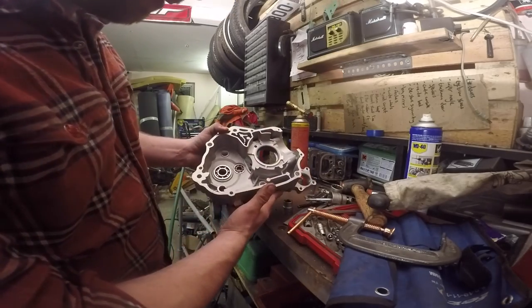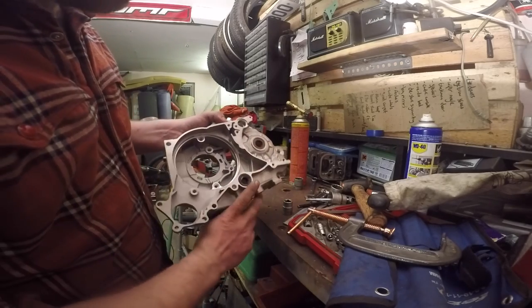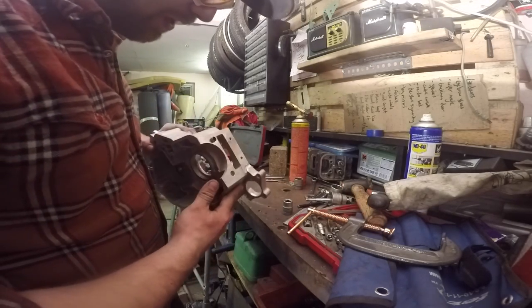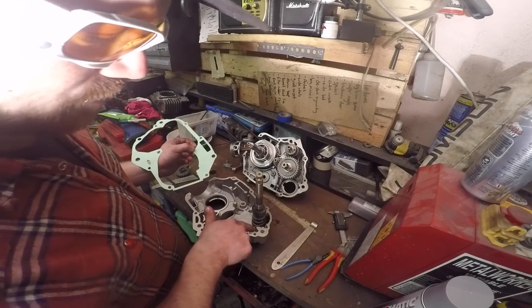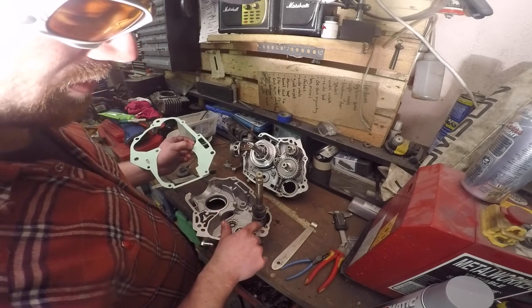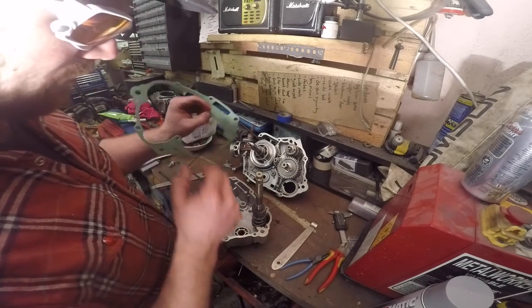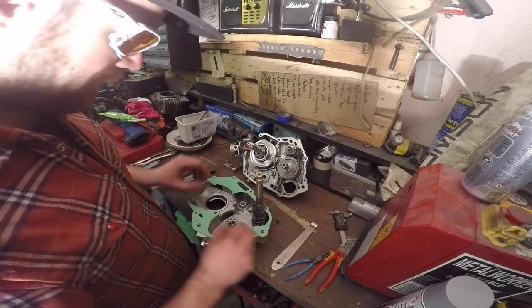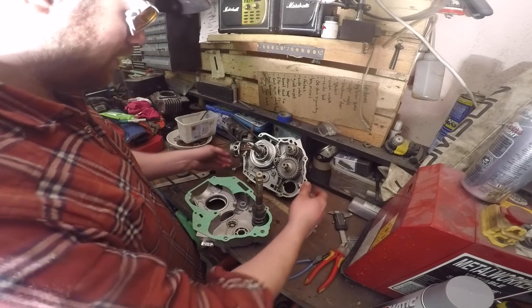That was a wrestling match, but we've got both bearings in now, and both seals. Really all we need to do is put these two studs in for the head, and we can start building it again. The kickstart shaft is in place — it's got a little spring on it. You need to preload the spring against the casing, then twist and drop. It's a complete fuss of a design, but it works. Put this gasket on, which we never forget to do. Never forget to put that gasket on. Ever.